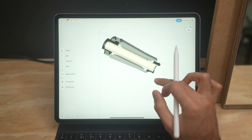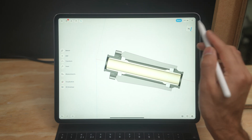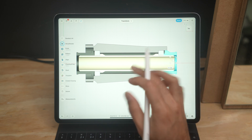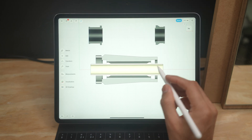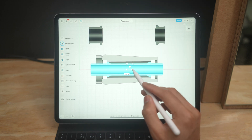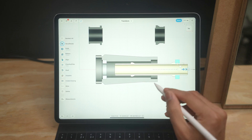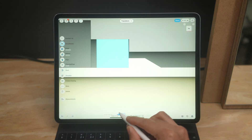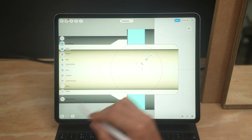I've taken a couple of ballpark measurements of the hub, drawn this up in CAD, and then sliced it down the middle just so we can see what's going on. This isn't accurate but it's a good visual representation. The hub is simply two bearings pressed in onto an axle. The axle is, from what I understand, slightly oversized, which pushes out on the bearings on the inner races creating the preload needed. So the play is likely in the tolerance fit either between the bearings and the axle or the bearings in the hub. Something's moving that shouldn't be, so our best bet is to repress with a new set of bearings and some Loctite.